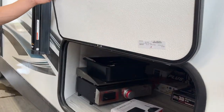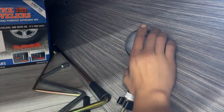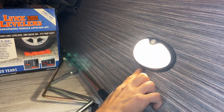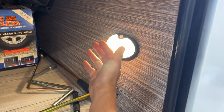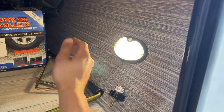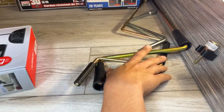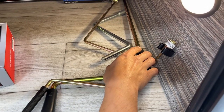The other end of your storage compartment flips open, and right up on the wall you have a dual-function light. On the bottom, the switch toward the wall puts it in single function — on is on, center is off. Switched to the left, that's dual function mode, using the motion sensor: without motion, it'll turn itself off in about a minute; once it senses motion again, it turns itself back on. There are also manual overrides inside here — one for your slide out, a small S-hook for your tongue jack, and one with a three-quarter inch end for all of your stabilizers.